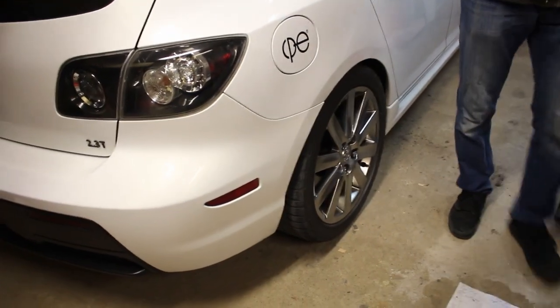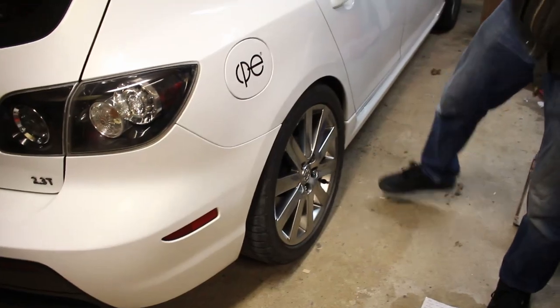All right, now the first thing is to jack up this jacked up snowball. I'm going to take the rear wheels off and put some jack stands under here so we can work safely. Disconnect the rear shocks from the control arm, slowly lower the control arm, remove the spring, stuff those bags inside the rear springs, and reinstall everything. Route those cables, run our lines, and figure out exactly where we're going to mount the Schrader valves.